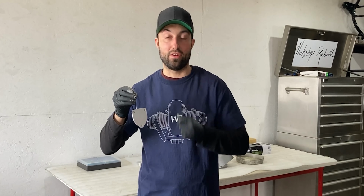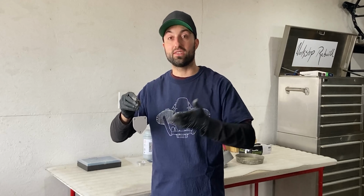In the meantime, while this was curing closer to the wooden stove, I was actually cleaning up the airbrush and the strainer because you want to clean off all the excess Cerakote so it doesn't harden onto your tools. The Cerakote cleaned up actually pretty easy with acetone, so I would just recommend clean up your tools right after you're done spraying your parts.